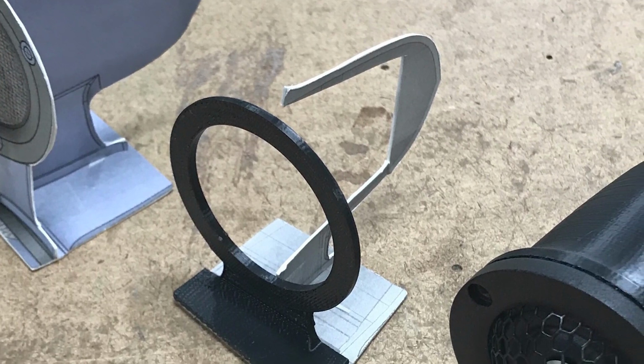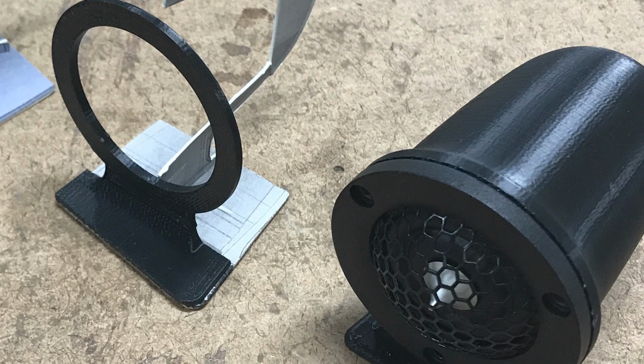The tweeter pods were designed in CAD first. So I basically drew a rough sketch of what I wanted and described it to my CAD designer, and put the part in situation in the car so she could see where it goes. And together we honed a shape that was pleasing and looked good. And we printed this shape in two dimensions on paper, and laminated that paper to some cardboard just so we could place it there. That was part of our process, where before we go to 3D printing and waste that time and material, we like to first print it out on paper, because sometimes that mock-up alone is enough to satisfy you that you've got a good design. And it's quicker and faster.